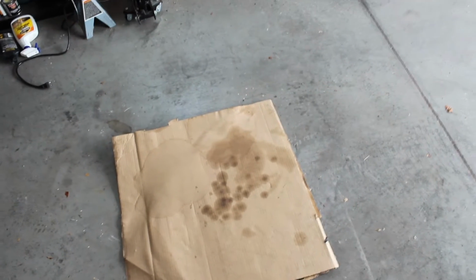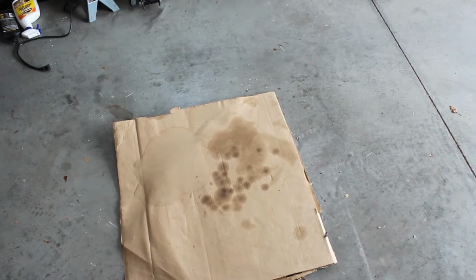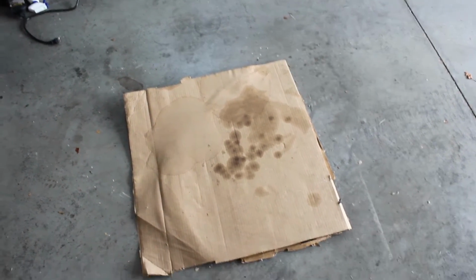but as you can see here, it's still leaking from that area, and I realized after looking at some of the forums that there is another gasket that is about impossible to find, but I did find one on eBay for 12 bucks. It's the upper VTEC solenoid gasket, which kind of looks a little funky. If I can find a picture of it, I'll put it in right here. So that's what that thing looks like, and it's actually on top of the VTEC solenoid control module thingy, whatever you want to call it.